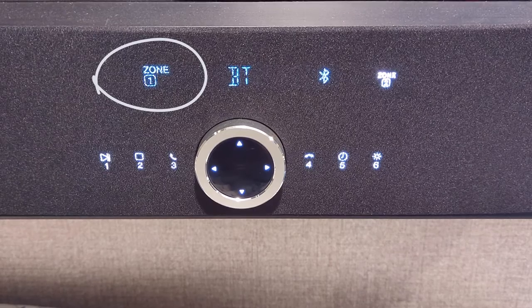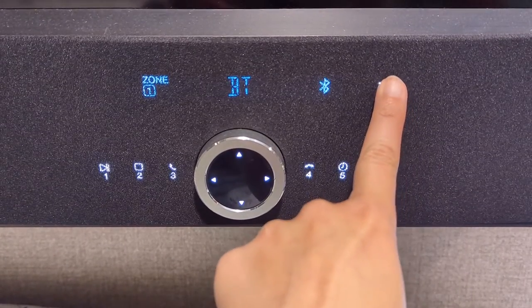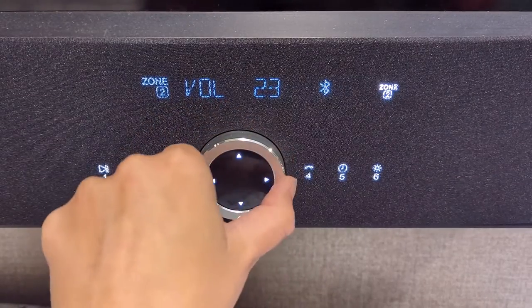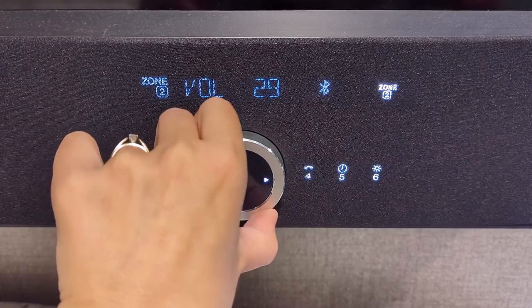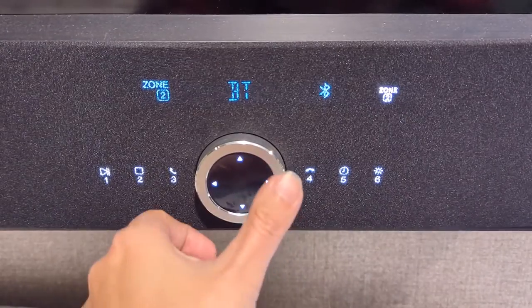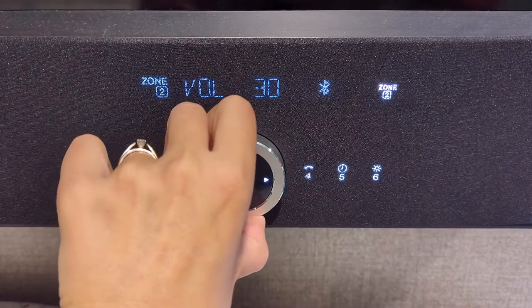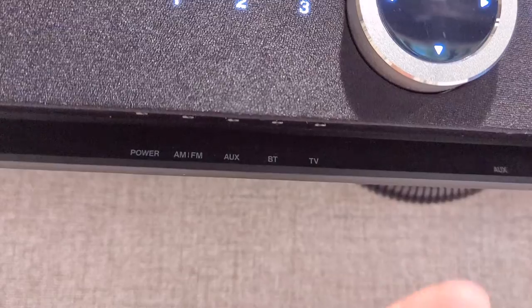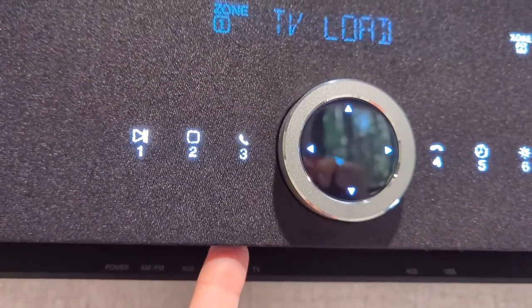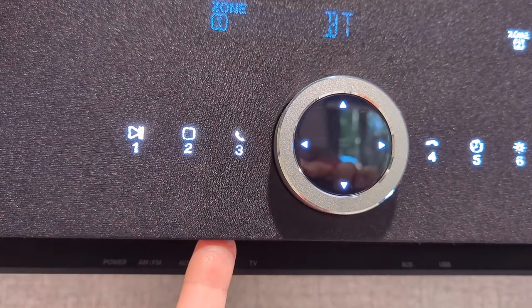You'll see Zone 1 on the left side and Zone 2 on the right side. The volumes are controlled separately, so click the zone and then adjust the volume. I like to turn the volume up louder than I think I actually need it, and then turn it down on my phone — it's easier to adjust it up and down on my phone. When I adjust the volume on the zone, sometimes that causes it to lose the Bluetooth connection, and then I just have to reconnect by holding down that BT button again. So I just turn the volume up louder on the TV and then decrease it on the device I'm playing it through, so I don't have to mess with the TV once it's all working.